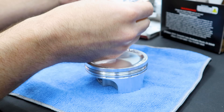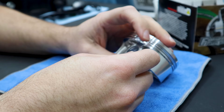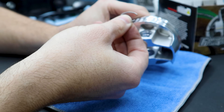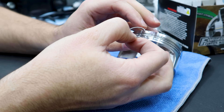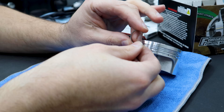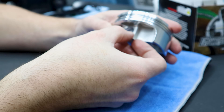I'm going to install one of my wrist pin clips. I'll put one on this side first, based on how the engine is oriented — that'll make sense in a minute. I can usually work these in with my thumbs and fingers; if I have to I can use a small screwdriver, but you've got to be careful not to nick anything on the inside. When orienting these clips, we don't want them in the horizontal plane because as the piston moves up and down really fast, the clip could compress and pop out.